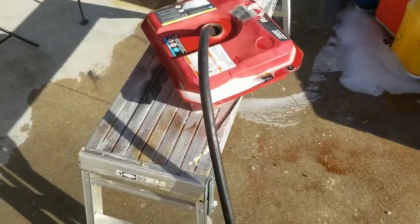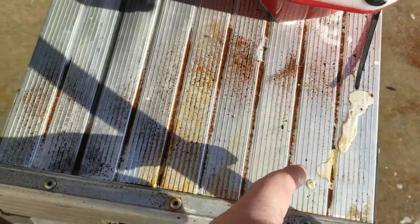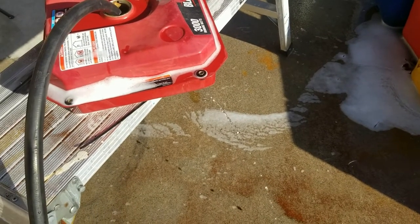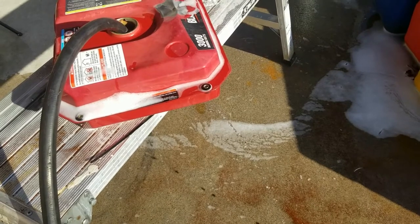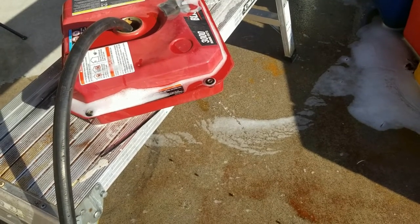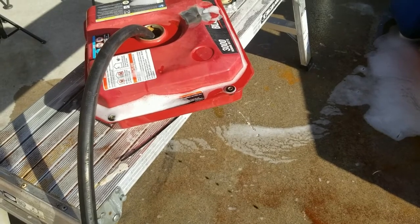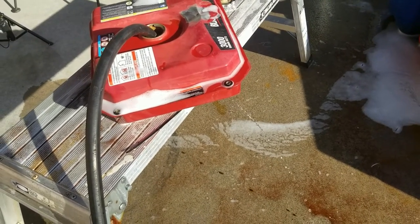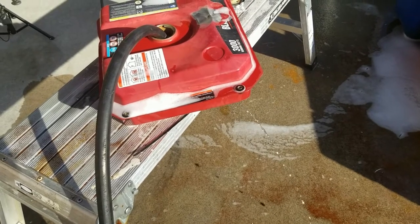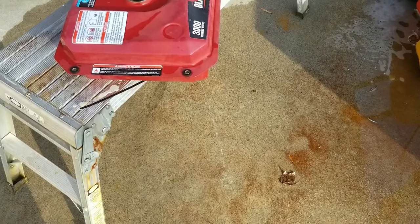I started purging the tank and you can see all the rust that's filled up the grooves on the little stand I have it on, and right here you can see all the residual rust just flowing right out of the gas tank. That little nipple right there was clogged up before and wouldn't shoot a stream because it had so much rust in it — I even tried sticking a rat-tail chainsaw file up in that nipple to clean it out and it wouldn't work. After putting the cleaner in and letting it sit a few hours, then shaking those bolts around, it really helped break all that rust and old gas residue loose. Now it's got full flow.